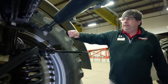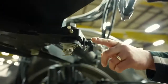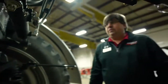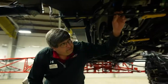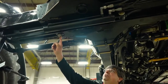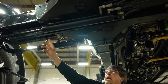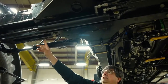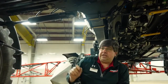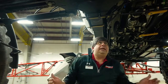Another service point: the steering cylinders. I have two grease nipples — one on the outboard and one on the inboard — and I want to grease those daily as well, both right and left-hand sides. To set my steering width, I can adjust from 120 to 157 inches by loosening this bolt and positioning the teardrop. There are numbers on the slide axle showing the distance. There's a switch in the cab to adjust the axles, and all four axles slide out at the same time with one switch.